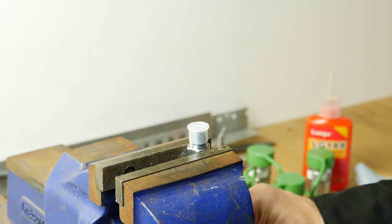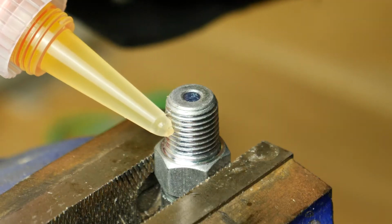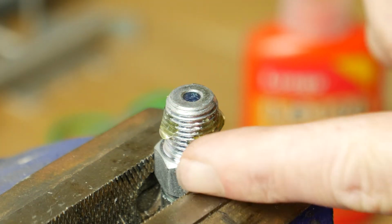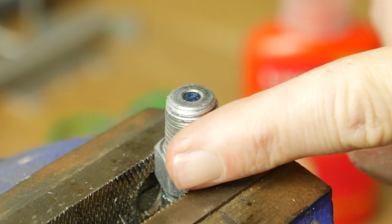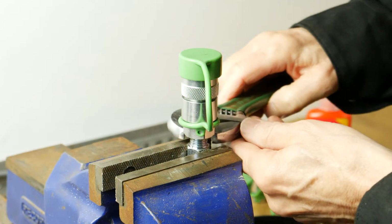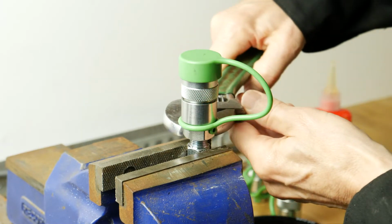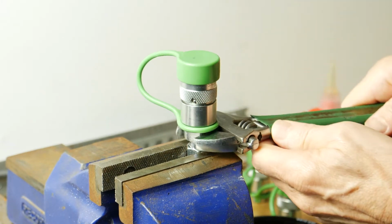There are 2 long hydraulic hoses, and each end gets a female quick connect fitting attached. I found the simplest way for me to do these was to use a vise to hold the end. I applied liquid thread sealer, screwed on the quick connect fitting, then snugged it down with a wrench. The vise held the end of the hose steady and made this job easy. Since there are 2 hoses, that means there are 4 quick connect fittings to attach.